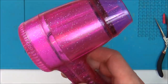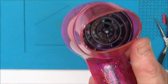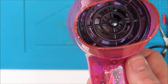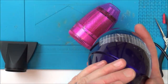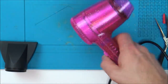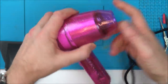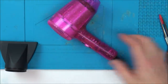I was just looking in there and thinking this is a very short hair dryer. My daughter's got long hair - if she comes out of the bath sopping wet and some hair was to go in that side... yes it would burn because of the coil. But there's 240 volts going through that diode there. I wonder whether it's possible to get a shock if wet hair went in there. Normally with a normal size hair dryer, your hair would have to get in a long way before touching anything that was 240 volts. But with this short one, it's just an inch. If you think they're unsafe, pop that down in the comments just to let me know.